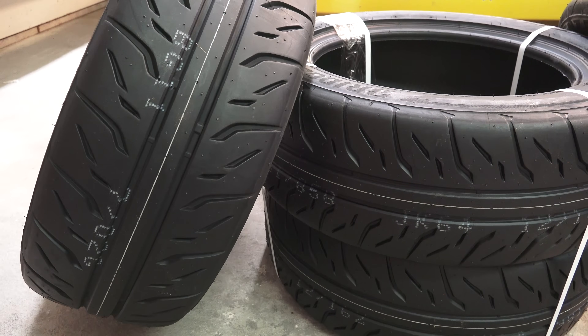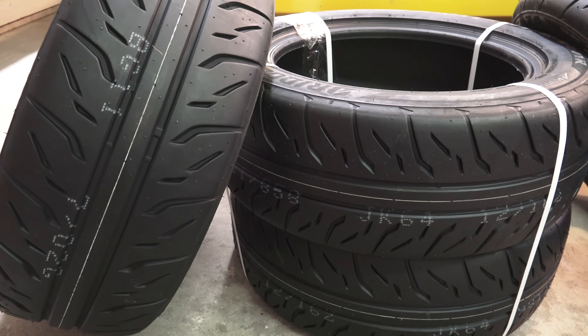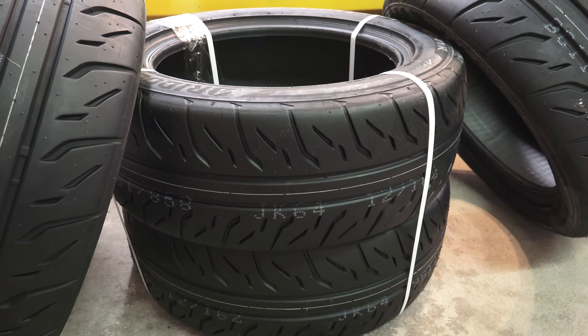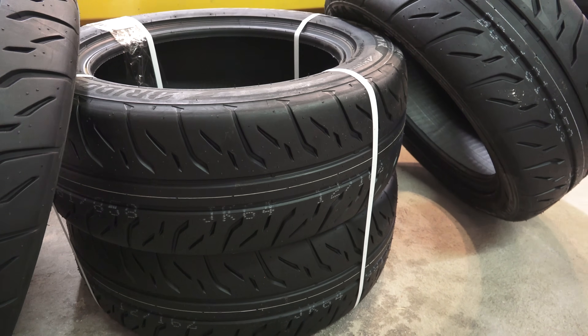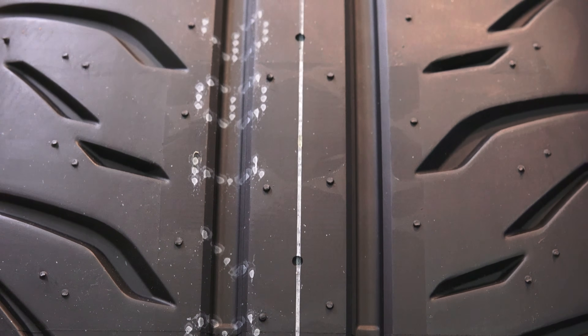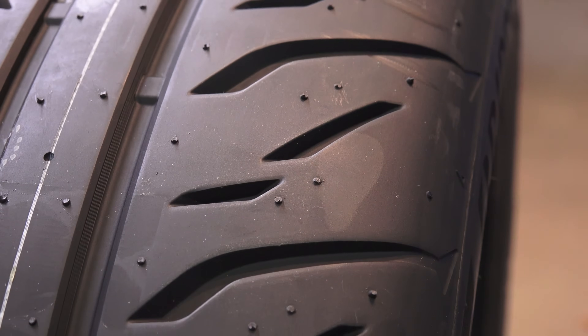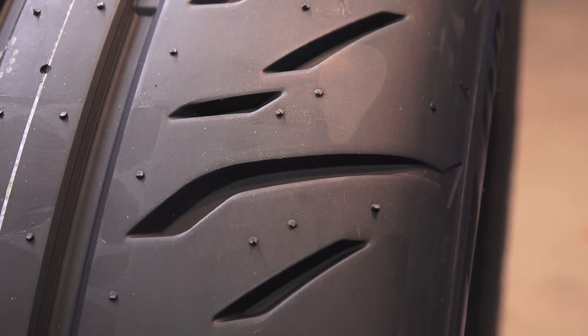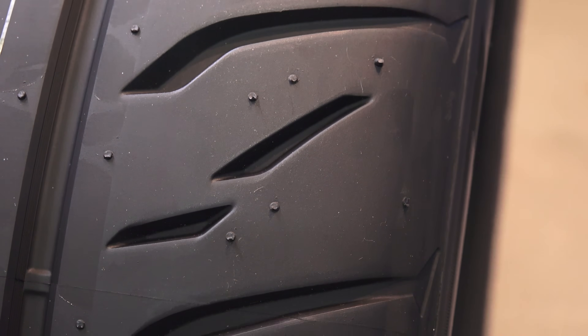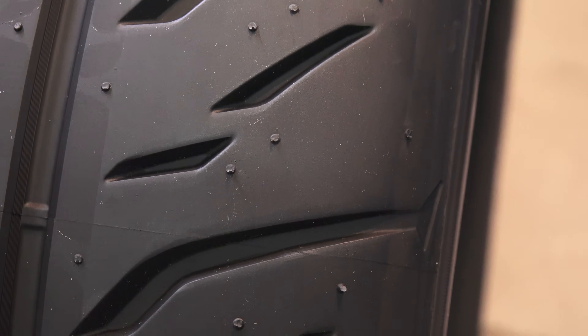What are some of the other advantages of a summer tire? Well, this RE71R tire specifically was surprisingly inspired by motorcycles, developed from a high grip polymer Bridgestone used in MotoGP. The tread pattern has a wide center rib, which gives you a lot of response in steering and turn-in, and it has massive shoulder blocks on the outside, unbroken, with no pass-through grooves. The stiff shoulder blocks provide high grip during cornering and for accelerating while going straight.